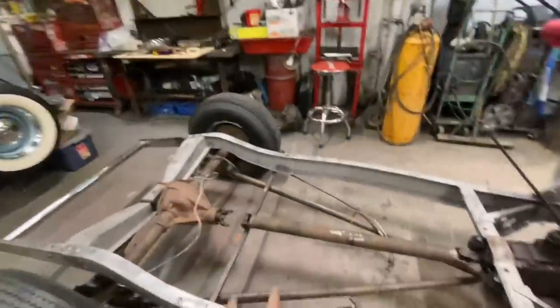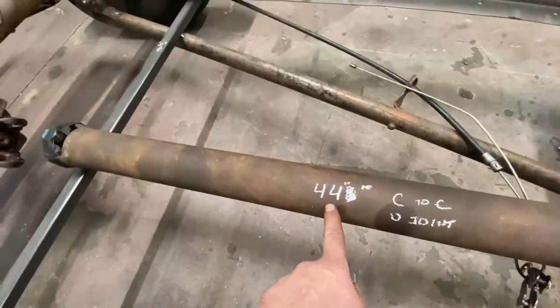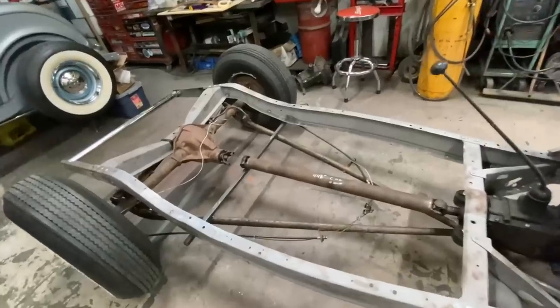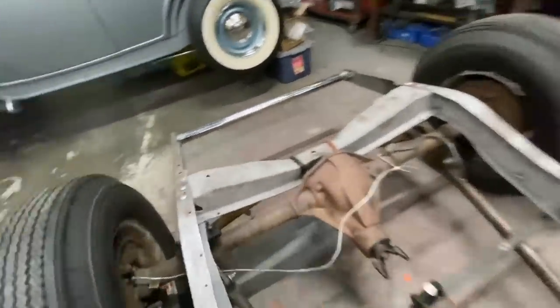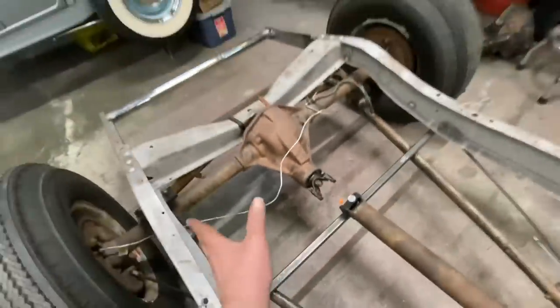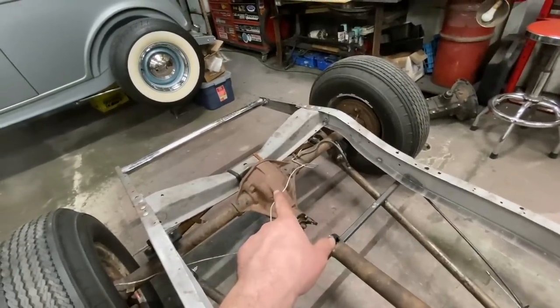Well, we can take the drive shaft with its new correct measurement over to Ken, and he can put it in his drive shaft stretcher and make it longer. We can weld up these guys now and take this brace out. This was just holding the wishbones together because I didn't trust the tack welds on there underneath the tension of the spring.